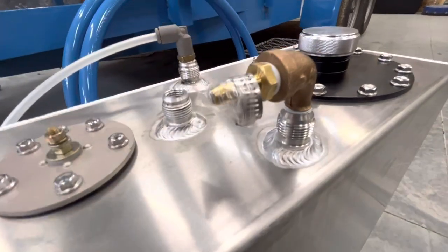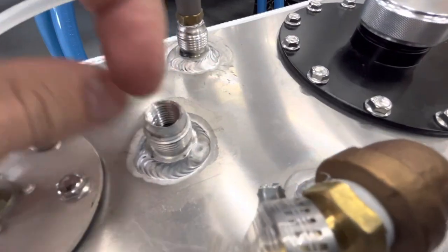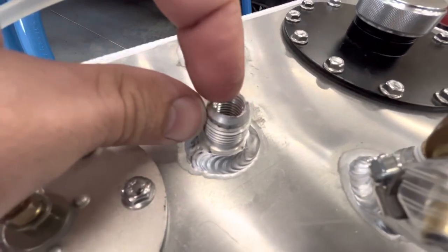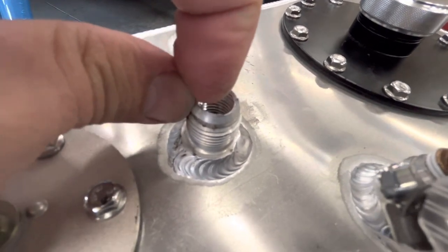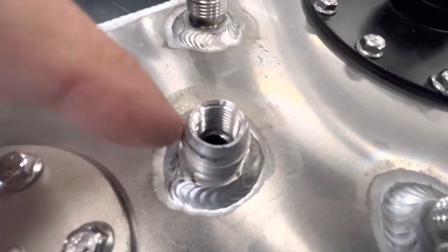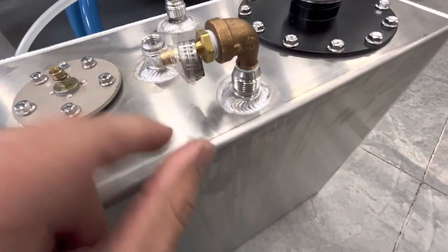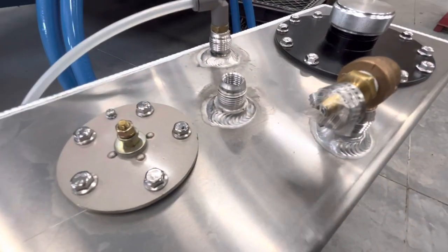So what we ended up doing is the wall thickness on this one in particular — if you can get a dial caliper, or if you have a friend who's a welder or metal fab or anything, they can measure. The wall thickness inside of the exterior thread here is one-eighth of an inch. So we are able to thread a quarter-inch pipe thread into that and then just screw in a fitting here for the vent and a brass fitting into an elbow here for our fuel supply, going five-sixteenths. So a very easy fix.